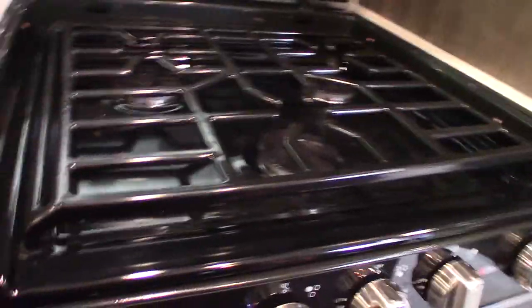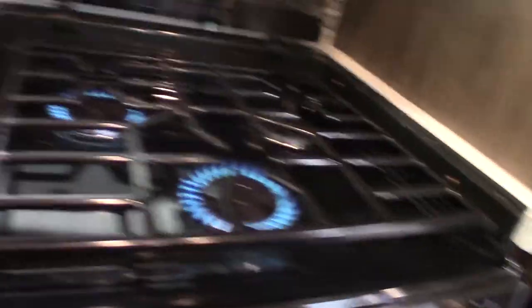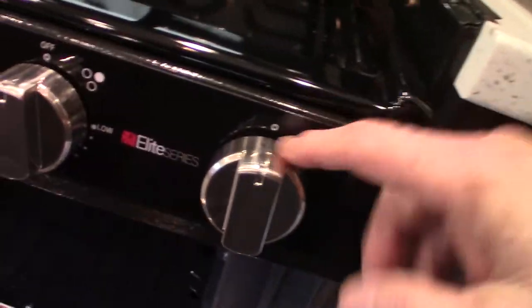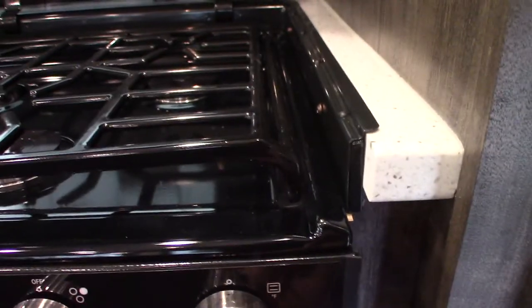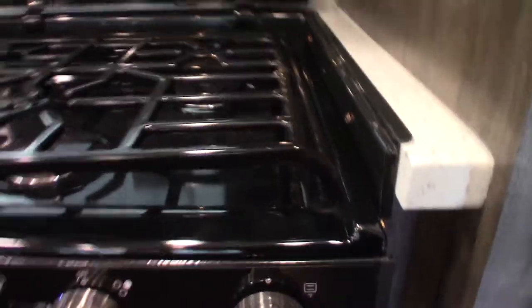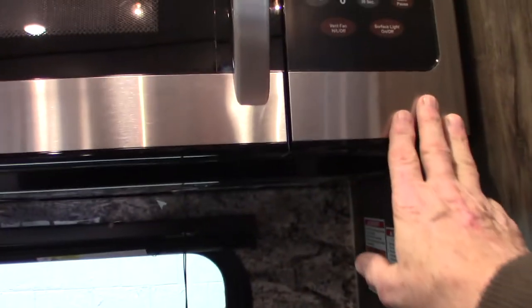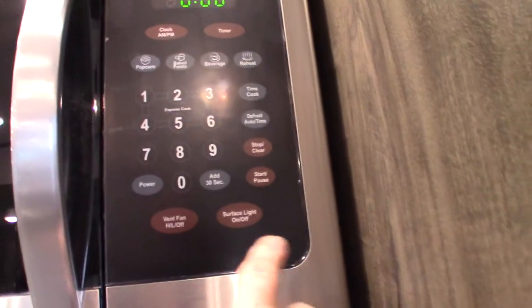The refrigerator is self-evident like any other RV. The stove has three burners and three knobs. The oven knob is right here, and at the bottom there's a pilot light all the way to the back — you depress it, light it, hold for about 10 seconds after it lights, then go to whatever operating temperature you want. When you shut it off the pilot light goes out too, so you have to relight it each time you use the oven. The microwave has a two-speed fan and lights.